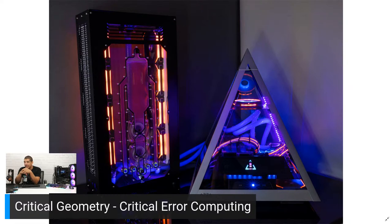Then they've got some anodized thumb screws, right? This is a 12900K running on a MAXIMUS Z690 Extreme, then on a 3090, which has been, of course, water-cooled, 64 gigabytes of memory, and impressive. They must be running probably the latest UEFI and also have a pretty strong IMC, because it's pretty rare to be able to get up to 5600 MT in a 4-DIMM configuration, so that's pretty cool.